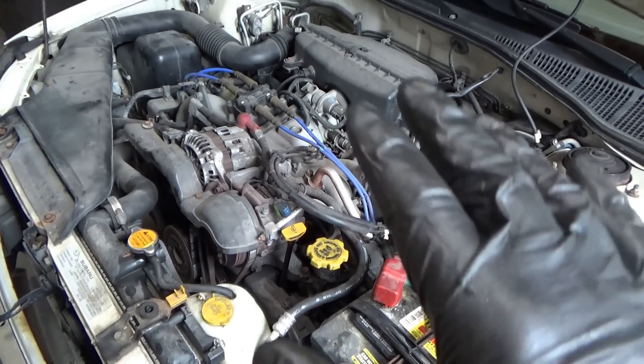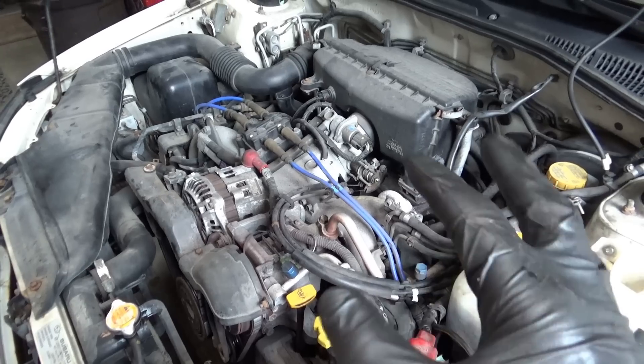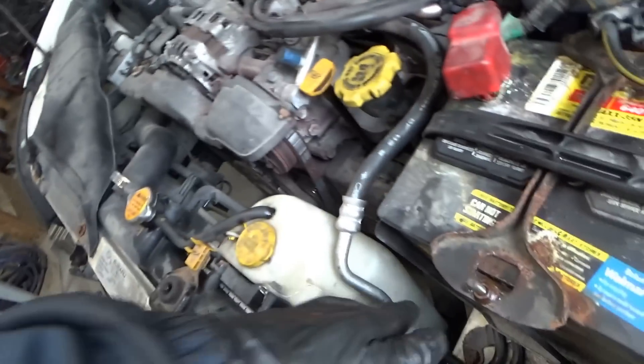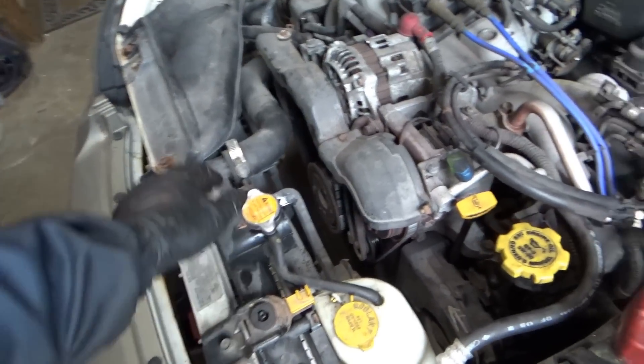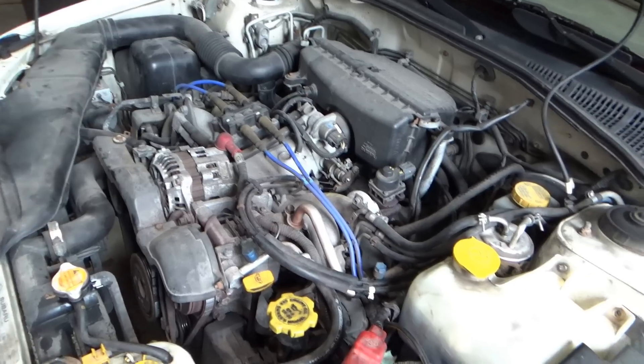It's all back together. I torqued that top center bolt a little over spec, maybe to 90 to 100 foot-pounds, and actually on the borescope, when the coolant was under pressure, I didn't see any more seep. So I'll keep you guys updated. We'll give it back to the customer and tell them you might want to start saving for a new vehicle — this one is giving signs that it's going to get expensive pretty soon. But you never know. I topped off the coolant to the full mark — we'll do a controlled experiment and go from there.